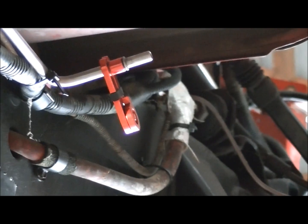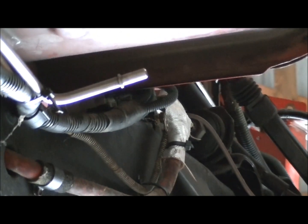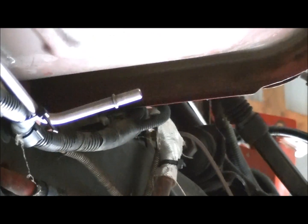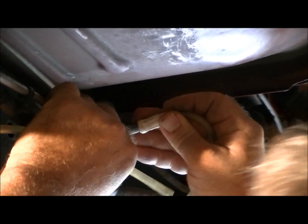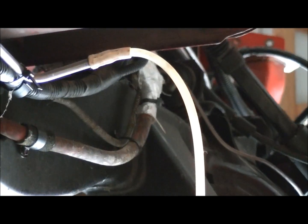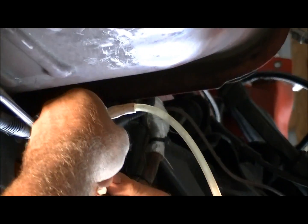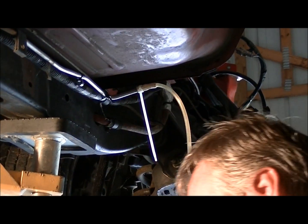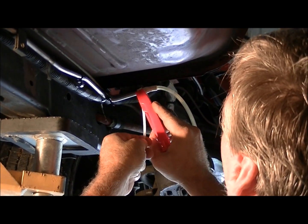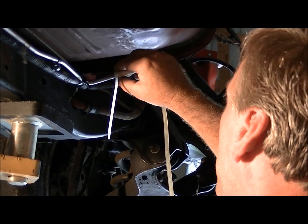Now while we're under here, that fuel line is not going to be reused so I'm going to take the tool off. I want to be able to drain the fuel tank at this time. There is some fuel left in this truck and we're going to get rid of it by triggering the relay later, but we might as well save a step. We're going to slide a piece of fuel tubing onto the nipple of the truck and secure it — just put a little zip tie across that and cinch it up with my zip tie tool, because when we start triggering that fuel pump relay it's going to start to sputter fuel out.